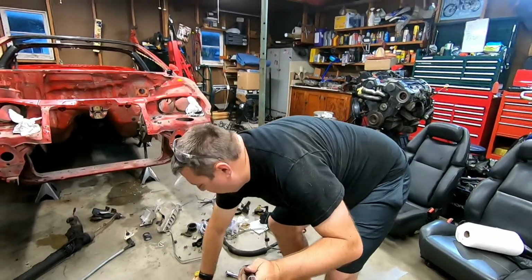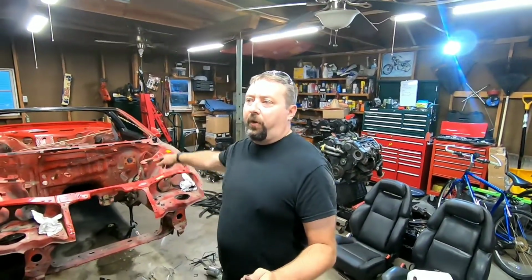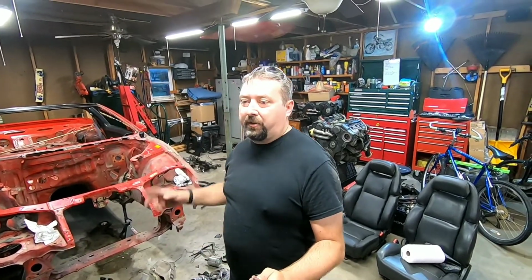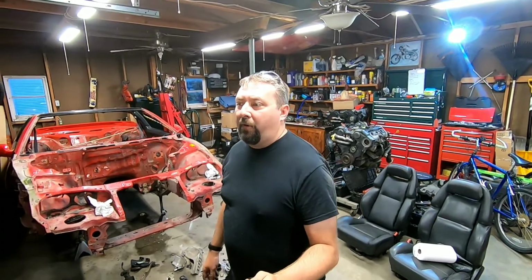The other thing that I ended up using was another line wrench. That was for the brake line on the front there. I'm going to have to do that again because there's a block, a bleeder valve there, it looks like, which is interesting. I didn't know that was there, but now you know and I know that's there in the engine bay for the driver's side front before it loops up.